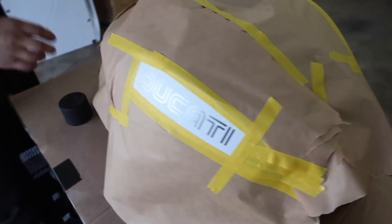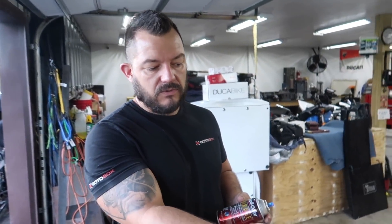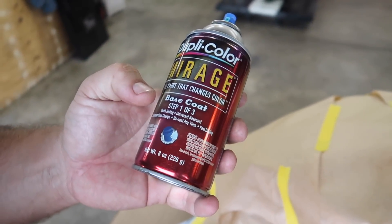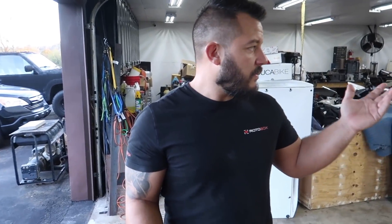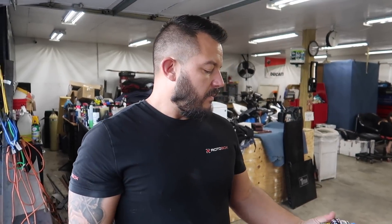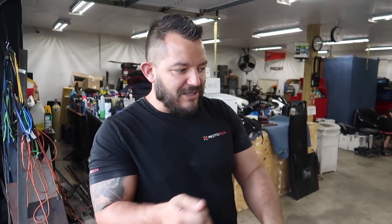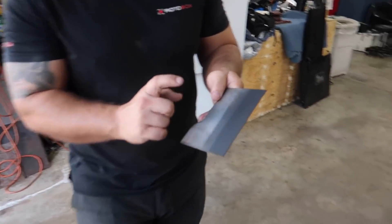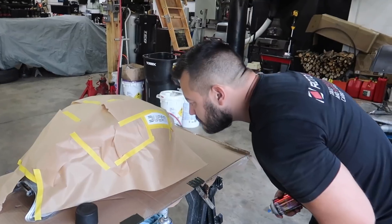We got the whole thing masked and we're ready to do the painting. To paint the stencil, I decided I'm not going to mix up paint because that's almost pointless for like one square inch of lettering. So I have this really good Dupli-Color — it's base coat. We tested it out, it's phenomenal. This stuff is awesome. If you're not using primer, if it's going on bare metal, stencil work can be pretty tough because you're going on bare metal. We did a test run — bare steel, brushed steel, and look at the matte finish. It turned out really nice. We have the PPG base coat but I'm not mixing. So here we go, cross your fingers. Dotto Throttles and Paints.